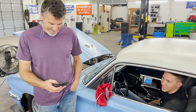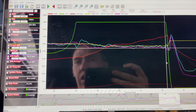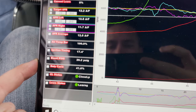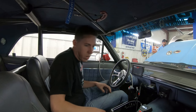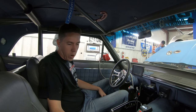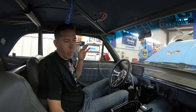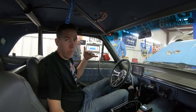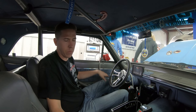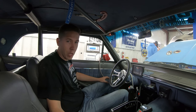Here is the data log: 11.7 air-fuel ratio — a little fat — but 20.2 pounds of boost, so not bad at all. We're going to try to get a high 1,300 or low 1,400 horsepower pull right here. This is the exact same boost level we run at the track when we've been going 8.50s at 172 to 176 miles an hour, so it should get a little spicy right here.